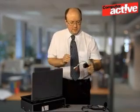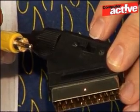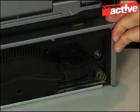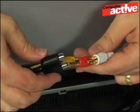And this is where the adapter comes in. If you've got a switch on the top, make sure it's set in the correct direction for recording and then plug it into the SCART socket. Then take the cables from the other end and plug them into the adapter, making sure you match up the colours correctly.